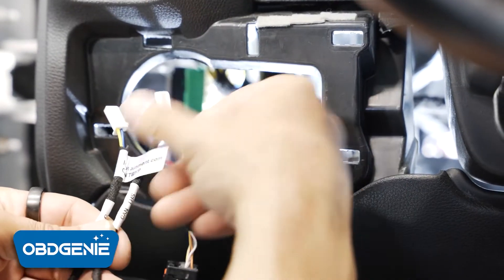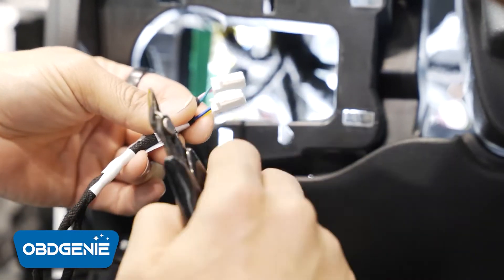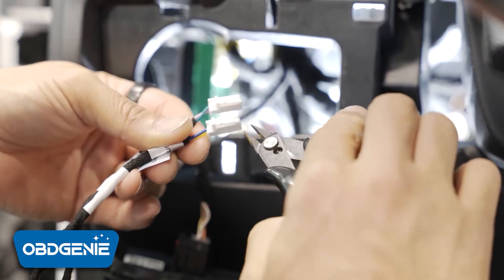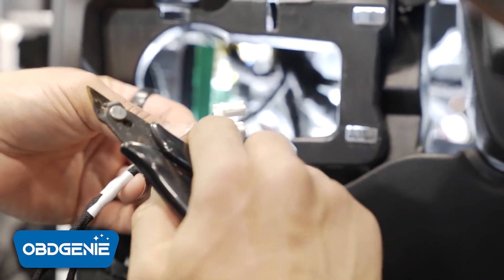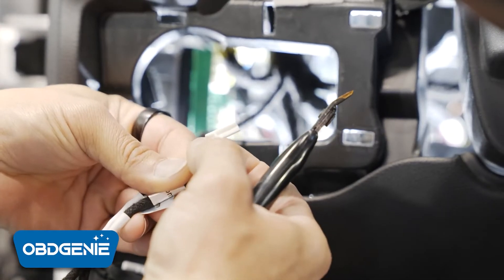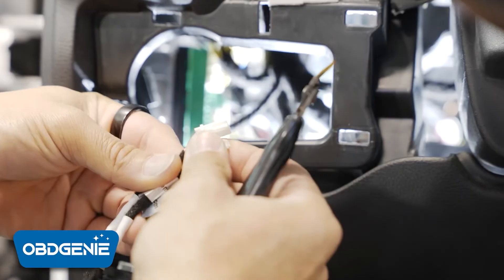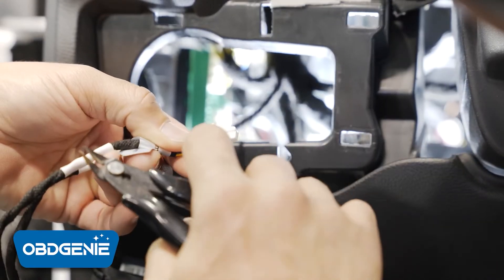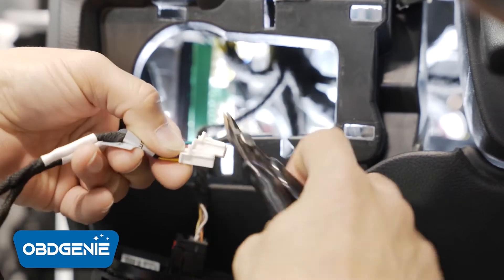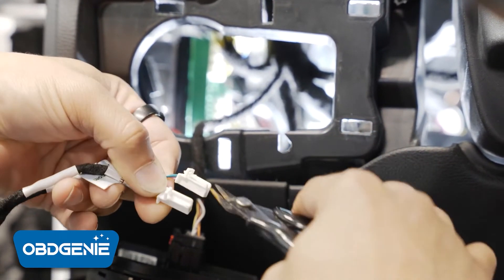You don't have to uninstall anything and you don't need any tools. Since I'm using this as a temporary part, I'm going to pull it back out, but these little tabs can be kind of a pain to unclip in that restricted area. So what I like to do is cut off the top locking tab on these connectors — like that one.